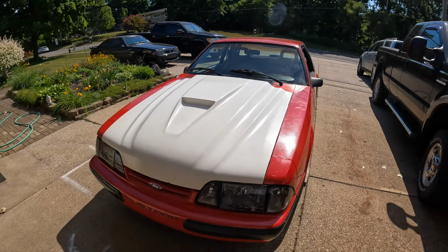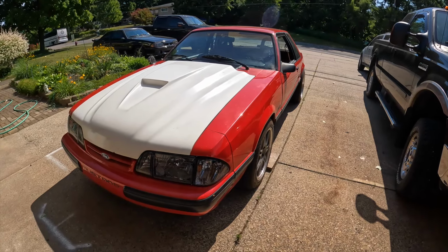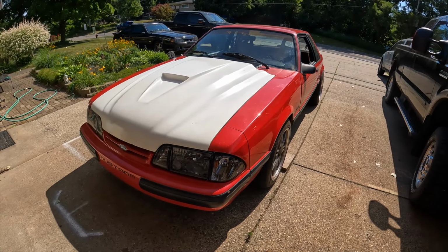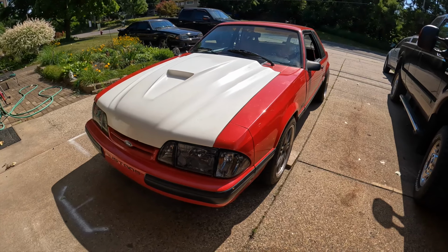But that is all I got for you. The fix for the alternator problem was just the ground. The ring terminal was up against the body of the alternator, and the smallest of contacts rubbed through the shrink wrap.